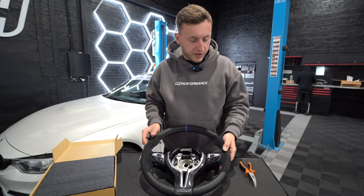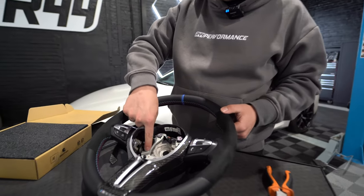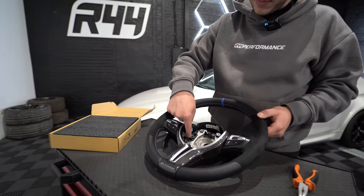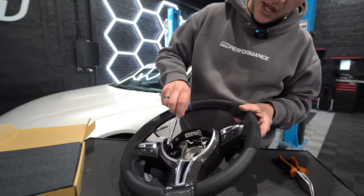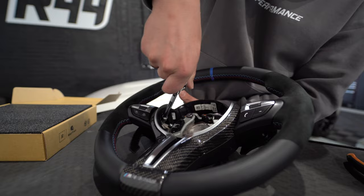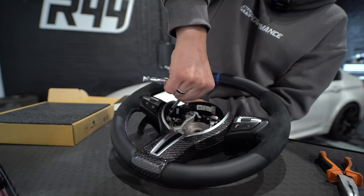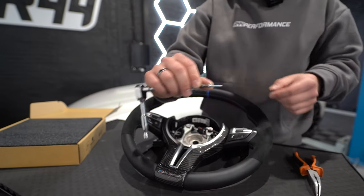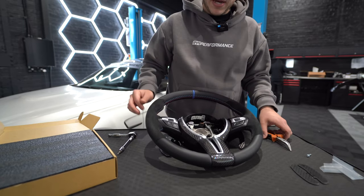Now at the workbench with the steering wheel in front of us — what you were doing with the flathead screwdriver was coming into this channel here and pushing back the spring to pull out the airbag. Make sure you unclip everything. There is one screw holding the paddle shifter in — it's a T25 Torx bit. Just hold the paddle shifter on the back, loosen it off, and put it aside. That's the silver screw there — we'll put it back into the new paddle shifter after.